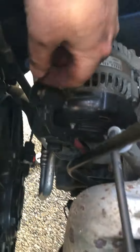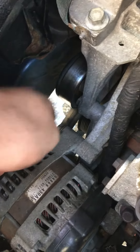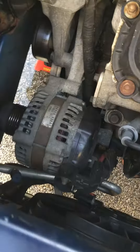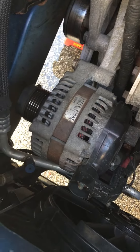Now I'm going to remove the battery positive bolt. I'm going to remove the bolt that you can't see, way down in there, right here, and this bolt here, and the bolt on the bottom, which you can see from the side of the car. So far, I am seven minutes into my repair, and we'll be back in a second.